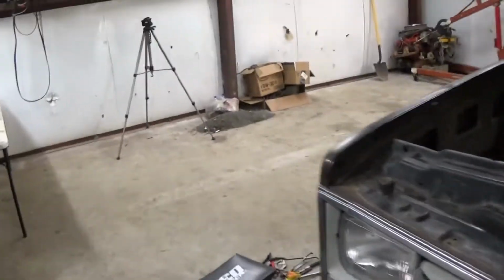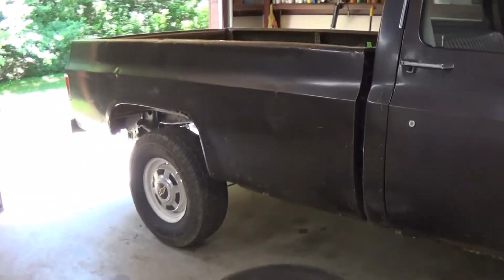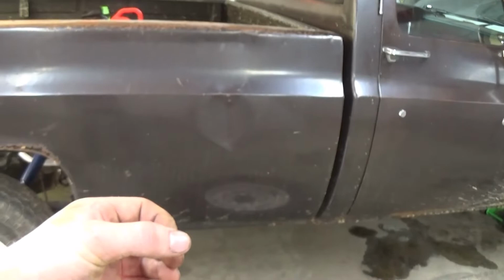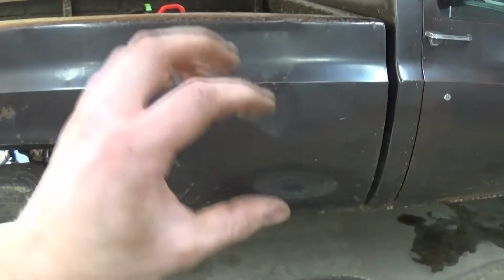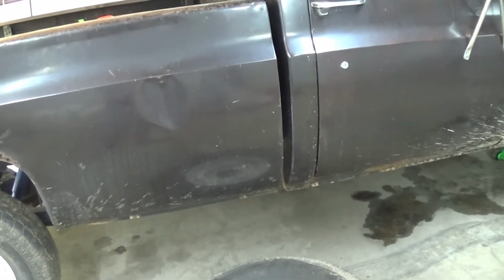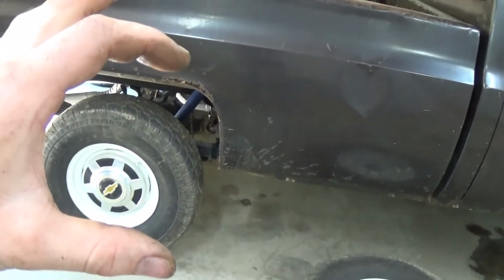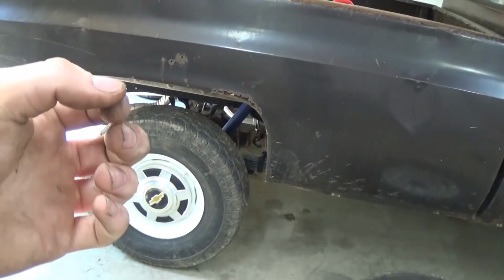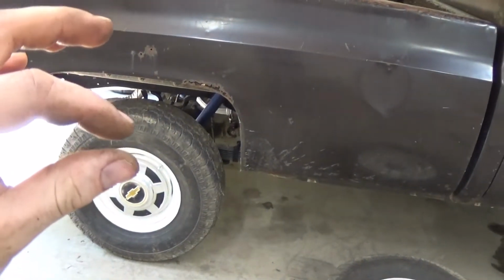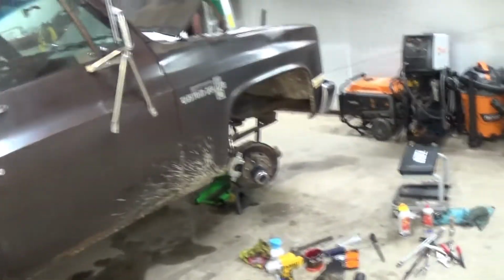I never told you guys why this truck left me stranded. What happened was the fuel pump came disconnected from the pickup tube in the sending unit. The little rubber hose slid off. So what I did is I dropped the gas tank out, and I put a longer piece of hose so it has more to grab onto, and I put 2 clamps on either side, and I got rid of those worm clamps that came with the pump, and I put fuel injection hose clamps on there, 2 of them per side. So I'm hoping that it'll hold up good. It should.